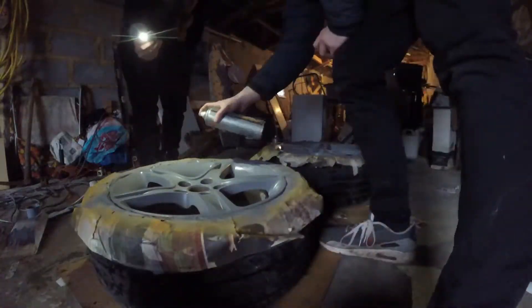So it's now the next day. Me and Milos finished off those back two wheels – it got dark so we stopped recording – but we ended up wet sanding down that black coat and put in a layer of clear coat. I know you're supposed to leave it a couple of days but we wanted to get it done so we did it anyway. This is how they look now and they actually look pretty decent to be fair – we went from looking like before to looking like black wheels now.